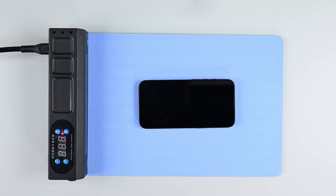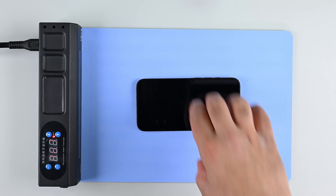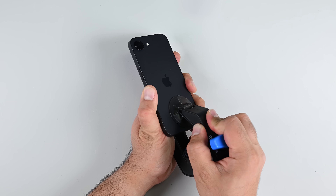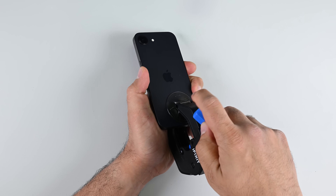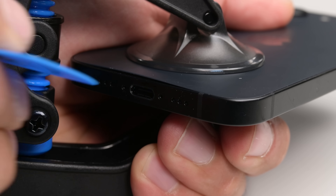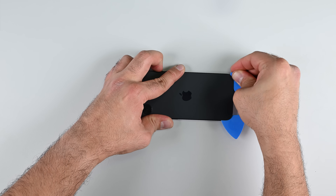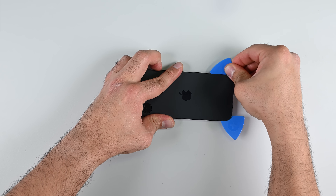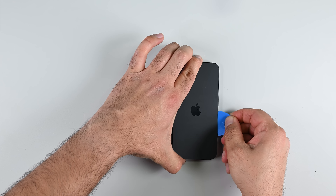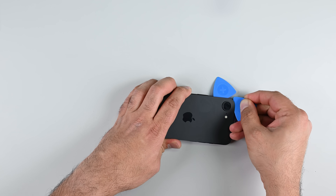The iPhone 14, which this phone's architecture is based on, was the first to introduce a dual-entry system that allows for quick and easy screen and back cover replacements. I'm removing the back cover first because that's my pathway to removing the battery, one of the two most common repairs carried out on cell phones, the other being screen replacements. After applying some heat, my lovely assistant Clampy is going to help me create a gap between the adhesive and the back cover where I can insert an opening pick. After that, it's a simple matter of cutting through the adhesive using a few opening picks from my ProTec toolkit. It's important not to push the pick in too far, otherwise I'll risk cutting through a flex cable.